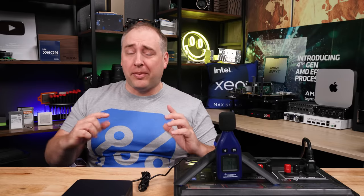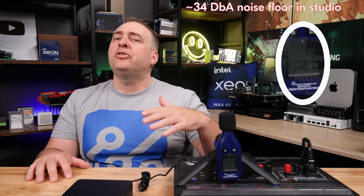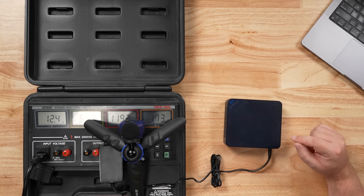Let's talk about power consumption and noise. The reason you get an all-E-core processor is really for lower power consumption. With this thing idling at the Windows 11 Pro desktop, our noise floor in the studio is about 34 dBA and we've gone up to about 35-36 dBA. Idle power consumption bounces around from about 11 to 12.5-13 watts, which is not bad — though it is more than the HP Tiny/Mini/Micro units which are in the 4-7W range. That seems like a difference in engineering between high-volume units like HP versus lower-volume mini PCs like this.